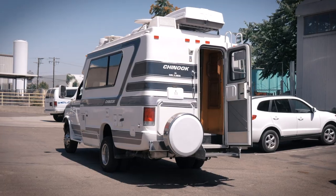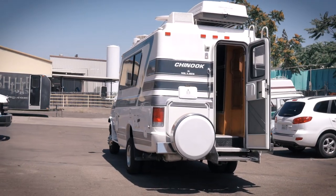When it comes to the back of this - all new bushings, all new everything - and then to top it off of course we added our Fox shocks to the rear. If you have one of these with that setup in the rear and you've taken it off, or you hate it, or you're thinking about putting it on, I wouldn't do it. What's great about this is all the additional clearance we're gonna have with the plumbing underneath, because otherwise that thing sat really low. If you were going to be doing any off-roading or remote camping you'd be tearing your plumbing off, and that's going to be a very bad day.